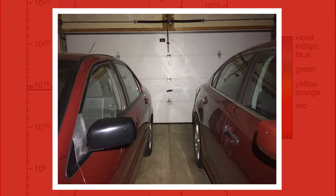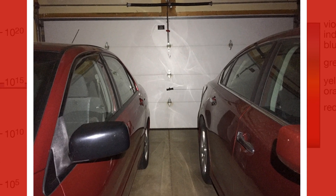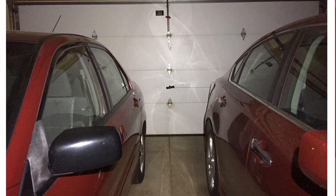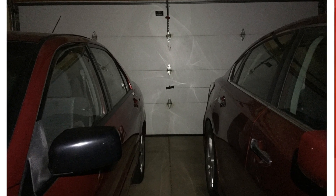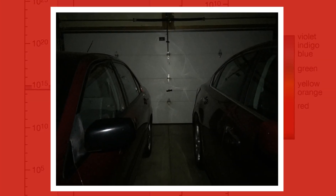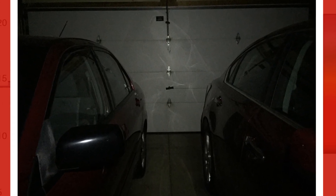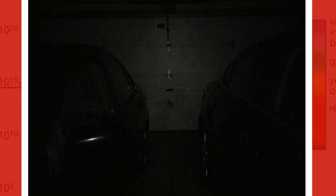Here in the garage I'm 15 feet away from the garage door. On turbo using nickel metal hydride, this is 320 lumens — expect a runtime of about an hour and five minutes. If you were running a 14500 battery, the throw would be about 70 meters. On high this is 130 lumens; expect a runtime of around two and a half hours. On medium this is 20 lumens — still lighting up the area with a wide diffuse beam — with a runtime of 16 hours.